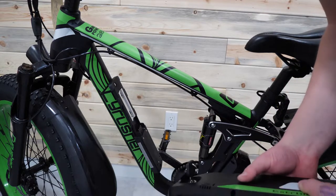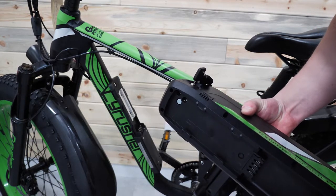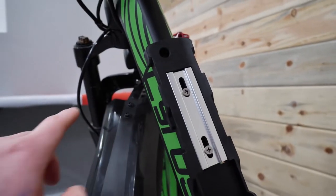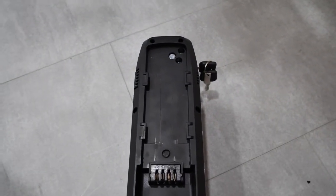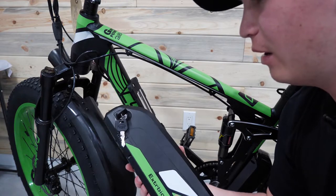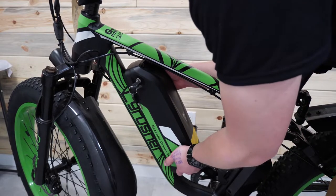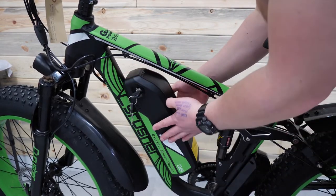When you're ready to put it back on, you're essentially just going to reverse the process of taking the battery off. You're going to use these rectangular prongs and line them up with the slots — there are four rectangular slots on the frame that line up with the battery. One thing to check is to make sure your key is still in the unlocked position, because if it's locked it won't sit down properly. Make sure your battery is also turned to the off position. Line up those rectangular prongs, set it on, and push down.